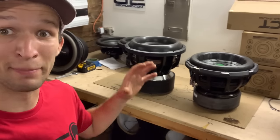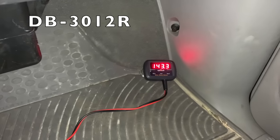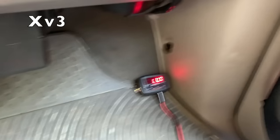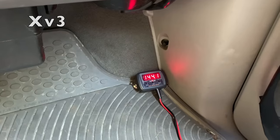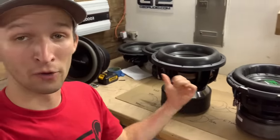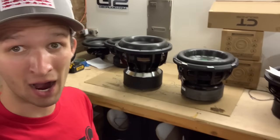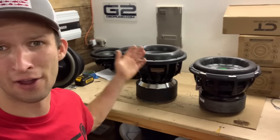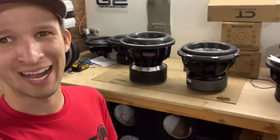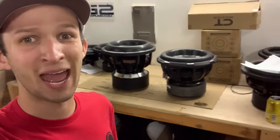Now, I also did a dB test, so I will show that as well. There we go, guys. Not bad. Got a 143.3. 144.1. Now, as y'all saw, this guy was slightly the winner. Though I had, now both of these are dual 1 ohm. I had them both wired down to half an ohm, both on the same amp and both in the same box. So kind of hard to say why this guy was louder. Is it really just a louder sub because it has more motor force or something? Or is there some other variable? It's really hard to say, guys, but either way, both got really, really excellent scores for being in such a large cabin, such a big car.